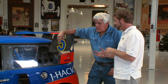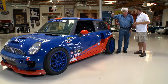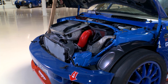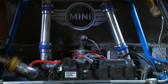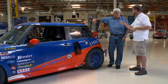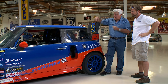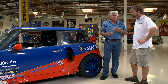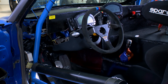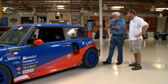All I had to do was make the mounting points, the cooling system, and the front and back with the rear suspension — it actually has front suspension in the rear as well. When you turn the key, are you starting each engine individually or do they both start at the same time? Individually. This car has two individual packages. So if the last three hours of your race event one quits entirely, you can disconnect the shift lever on that particular power plant and run either the front or the rear engine to finish. The throttle works on both simultaneously — they are fly-by-wire, so electronic gas pedals. Not dealing with cables going to carburetors. It's worked out quite easily.